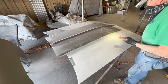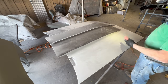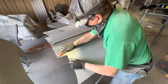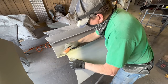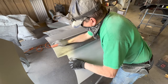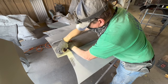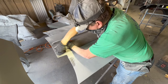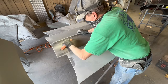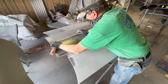Now, I'll give you a little more refined learning here. I was thinking about speeding it up and getting to the end of this because I'm starting to get tired of quacking, but I will talk a little longer about what's going on here. Here I'm sanding straight to get it straight, but then I'm going to turn that stick sideways again, a little steeper, and put more pressure near the front of the stick up by that reverse curve of the center of the hood